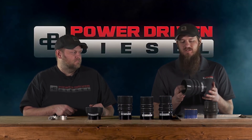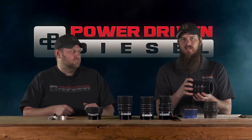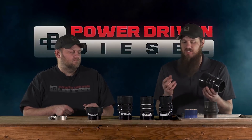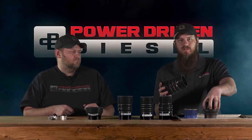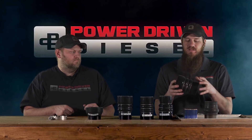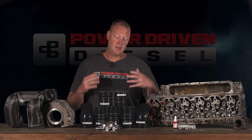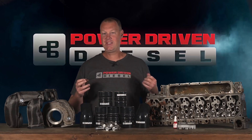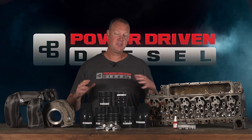Our boots are five-ply, much thicker. The steel rings on them provide mechanical support for the silicone material. Silicone is essentially a big spring — very stretchy — and the reinforcing holds the material together against pressure trying to expand it. When the reinforcing gets brittle and crunchy from heat, it loses all elasticity and can no longer hold pressure. You blow out your boots — it happens often on the hot side of your intercooler, and compound turbo systems get it really bad.